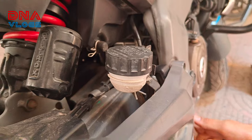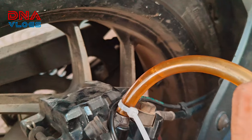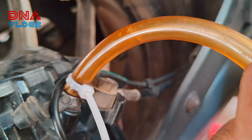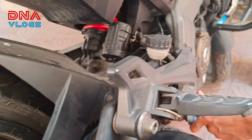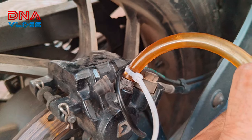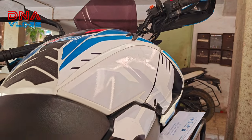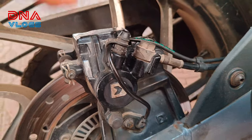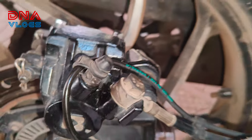Slowly start pumping the brake from there, then cover the brake reservoir back lightly so that if oil spills it doesn't fall on the colored parts. You can see the oil has started coming out and bubbles are also coming — once these bubbles stop, there's no air inside the lines and we are good to go. This will take quite some time because the oil from here first goes to the ABS motor at the top of the tank, and then via a second line it comes out here.